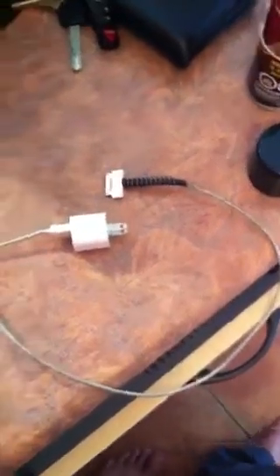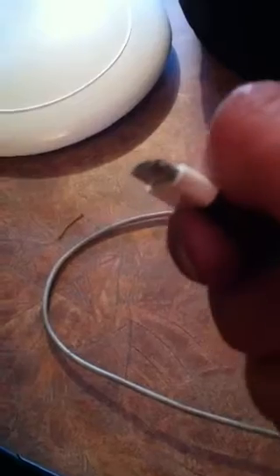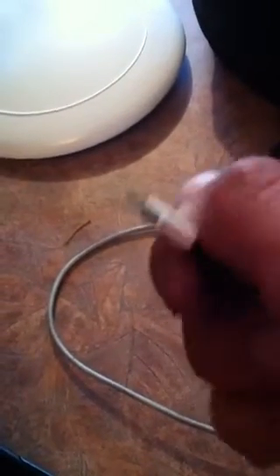So I looked up online a couple different ways of fixing it, and what I found the most effective way was: number one, taking your charging cable connector and sticking it in the bottom of your phone where you charge it, putting a little bit of pressure down so you end up pushing it down and lifting up. What that ends up doing is pushing the home button connector cable back in contact, and it worked really well.